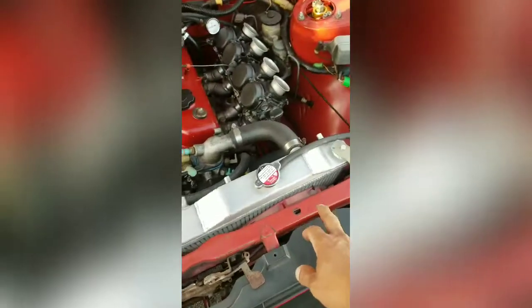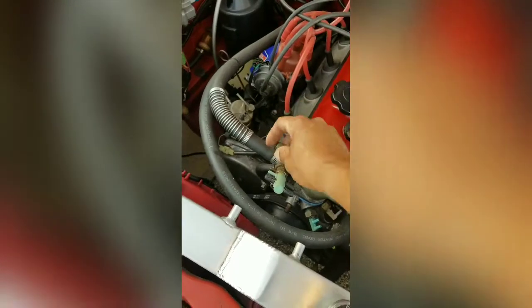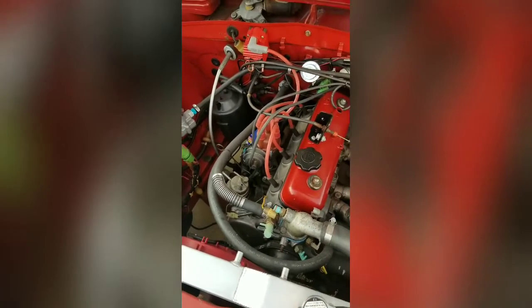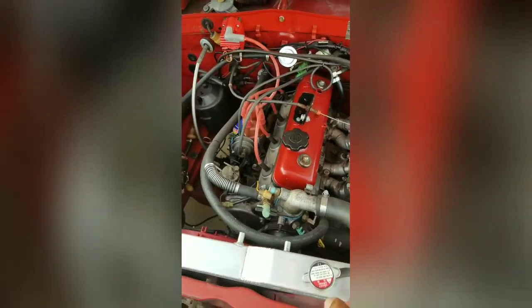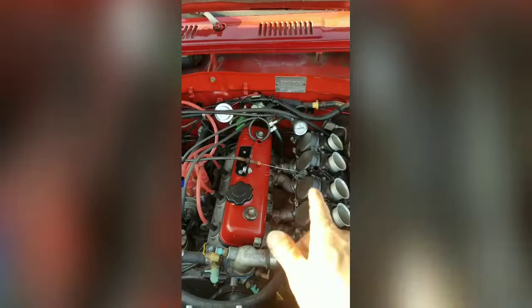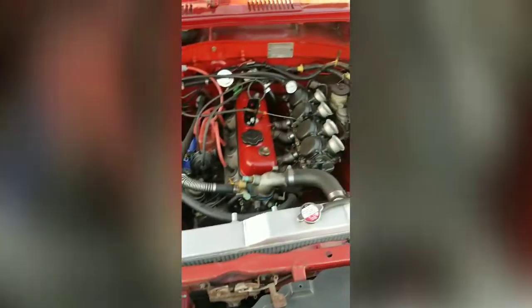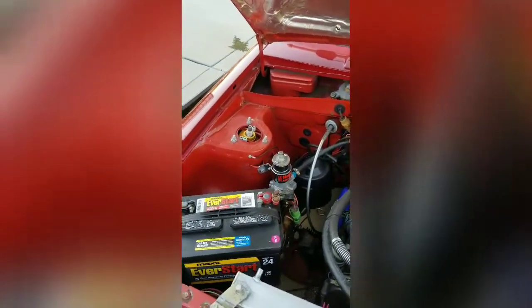Another thing I have to change is the radiator — it's an S2000 aluminum radiator and it is too big for the car. It's so big that I don't even have the fan hooked up right now. The temperature sensor is disconnected so the fans won't turn on, but the needle still stays below the midpoint at all times regardless, which means the heater doesn't work. It used to work flawlessly. I'm going to swap to a Honda Civic aluminum radiator and go down to one fan. That's what's next for this one, but for right now I'm just going to move it.